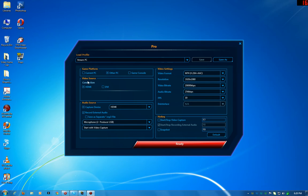As for my video and audio sources, both are set to HDMI. I had to get extra supplies to make that work — I had to get an HDMI splitter and a DVI-to-HDMI converter with optical audio input. It takes the DVI video and the optical audio and combines them into one signal through HDMI. That's how I'm getting sound through HDMI to my streaming computer. I wish they had included optical audio on the capture card itself — both optical and analog in and out.